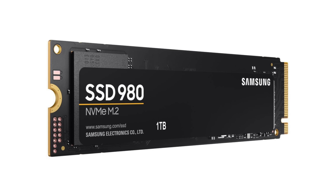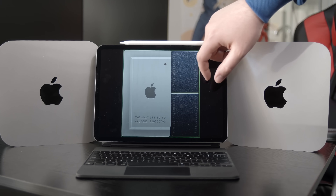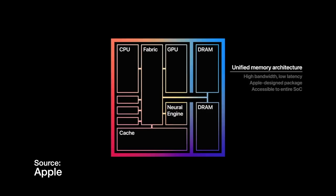When you buy an SSD from the store, it's going to have NAND chips and a storage controller. The idea behind that is that when you plug it into the computer, all of the management of where the data goes on the SSD is handled by the controller once the computer sends the data to it. But Apple's M-series chips share a lot more in common with something like a smartphone processor and a lot less with something like an Intel or AMD processor — basically x86. The biggest thing you'll notice with an x86 processor is that it is just a processor; you have it and then a separate piece for the graphics and a separate piece for the memory. Whereas with Apple's processors, they are SoCs — system on chips — meaning they include the processor, the graphics, the memory, video encoders, and the storage controllers.